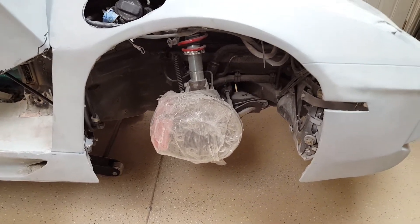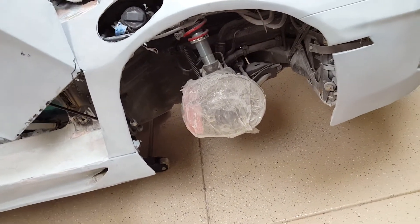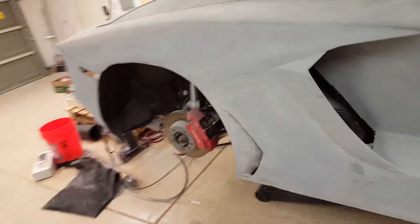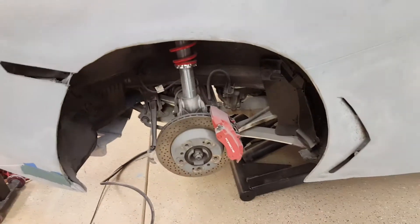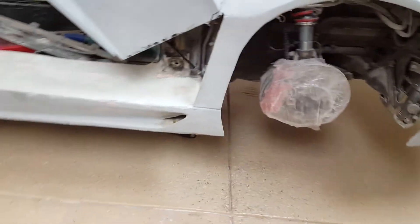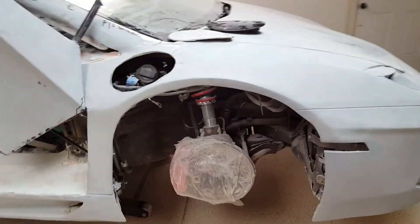As long as I get the right low profile it should look all right. The big thing is I really want 21-inch on the rear, but I don't know if you can go all the way from 18 to 21 — a lot of cars only have a one-inch difference. It depends on how the coilovers are adjusted; you can compensate by bringing them down a bit if the rear wheels are a lot higher, but it's still going to ride higher in the back. Maybe 20-inch on the rear — just a two-inch difference from the front.